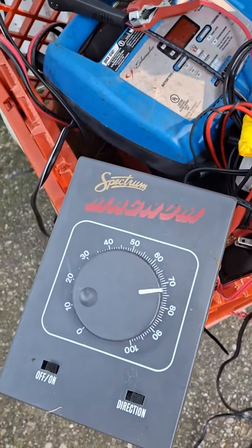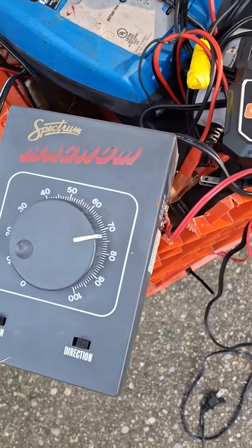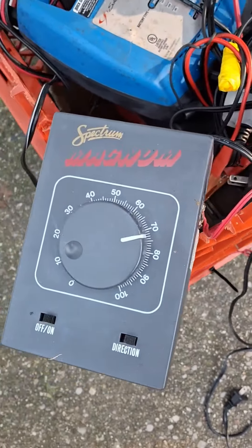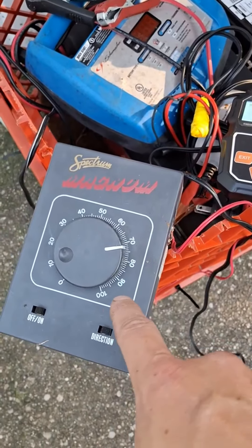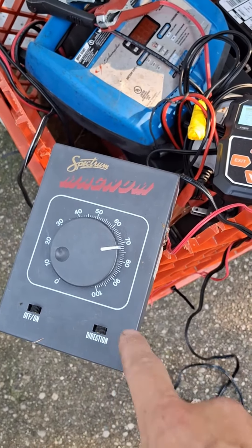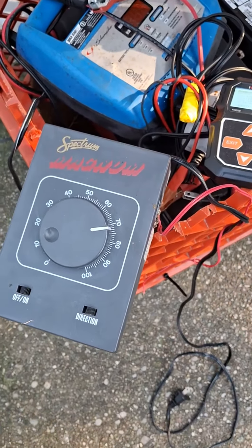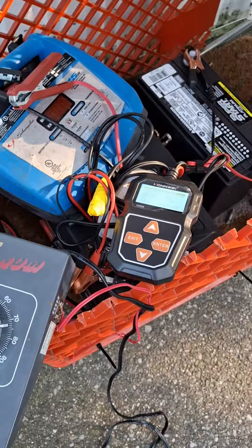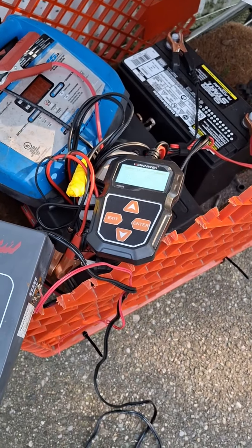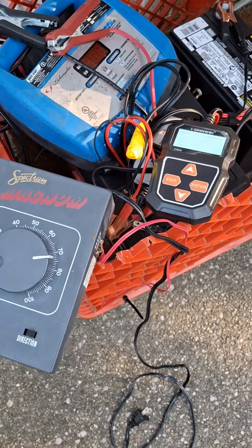What I do is I've used other power supplies, but lately I've been using this — just a power supply for, I think, like a train station or something. Picked up at the Goodwill for a couple bucks. I'll measure to see what the voltage setting is and make sure the polarity is correct, set it around 14.4 volts, and literally just tape it on to the terminals after I clean the oxidation off.